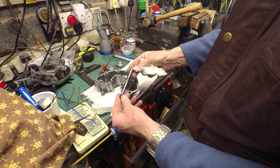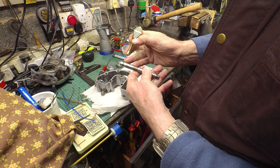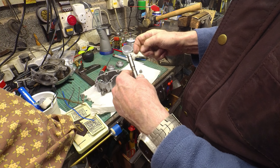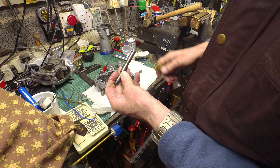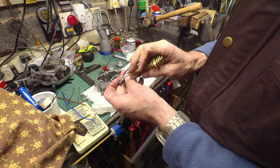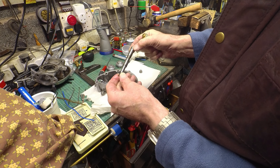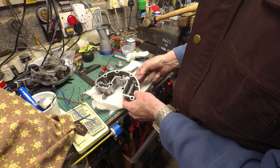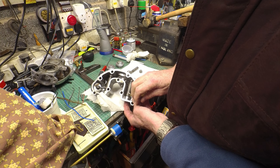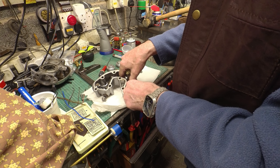So yeah, that taps out okay. It has indeed got the O-ring in there — it does look pretty flat, not much of an O-cross-section anymore. And sure enough there's the oil hole here and here, so I'll just make sure that's clear. The rocker arm is in here with the washers — there's a thrust washer there I think, thrust washer there, and then the spring washer at this end. I'll see if that'll come out without flying everywhere.